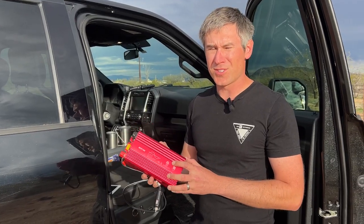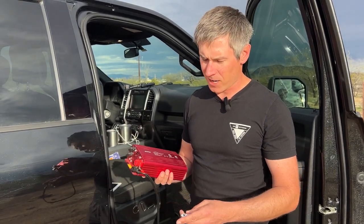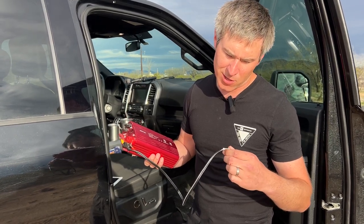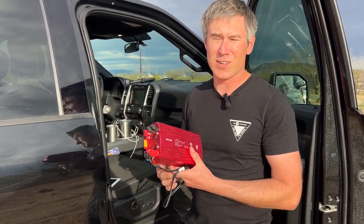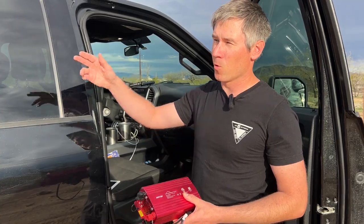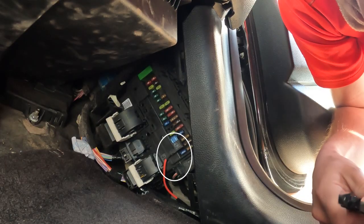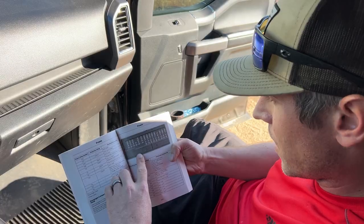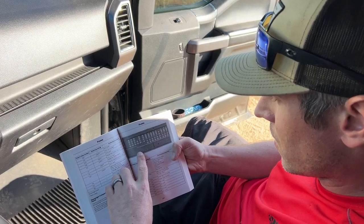With this 500-watt pure sine wave power inverter you don't get the true 500-watt capacity through the DC plug — it actually says right here: please keep load under 150 watts. But it is good enough to charge our laptops and it's super handy being portable, so we can move it between the cab and the rear of the truck as needed. For the RedArc unit I used a fuse tap — I selected a fuse slot for a feature this truck doesn't have, like the cooled seats, and simply tapped that fuse so the unit knows when the ignition is on or off.